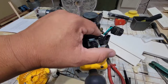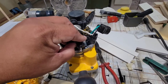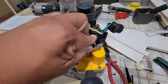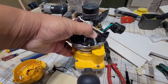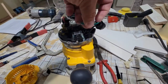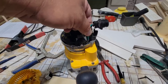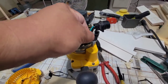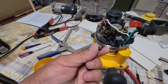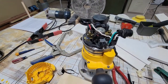Now we've got that in place, that's hooked up there, push pin is in there — that's really all there is to this. We're going to push this back into place. I've still got the plunge base on this so it's moving around a bit, but basically that's going to push down in there. Now your ground will connect up right in there, and there should be a little smaller screw that goes down through that ground through this, and that'll help hold that toggle switch in place.